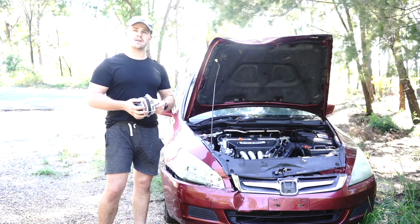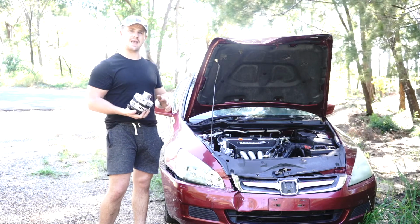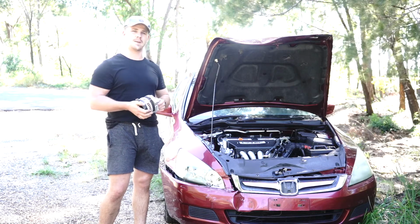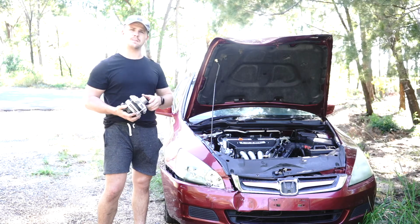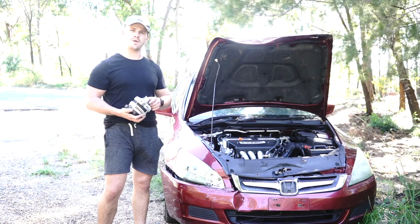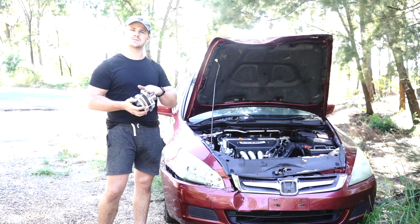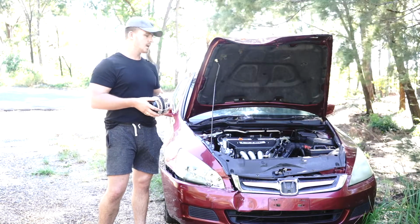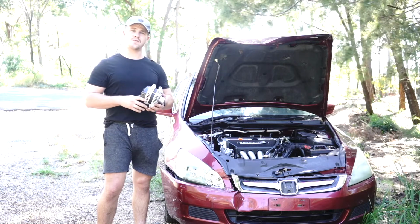The challenge we'll face today is finding enough space in front of the alternator to get to the bolts without scratching up our hands. I'm going to see if it's the best method to take the thermofans first. If it is easy to remove the thermofans, I would highly advise doing that before trying to get to these bolts with a ratchet.